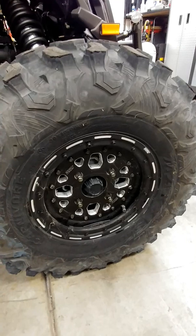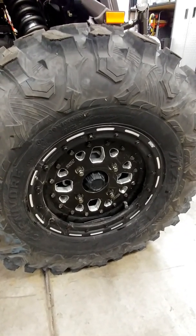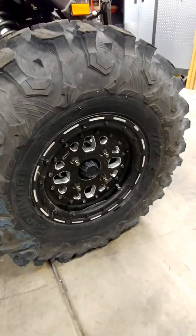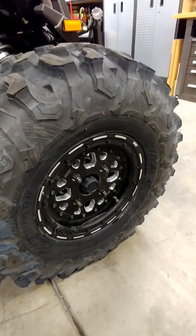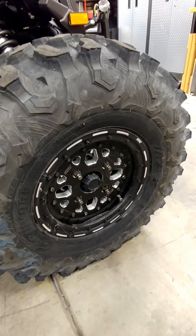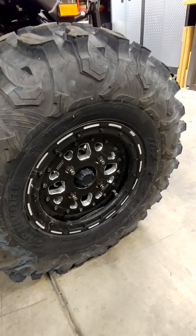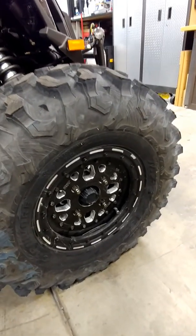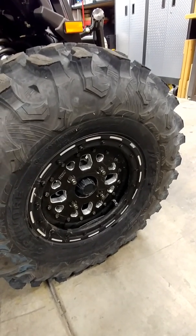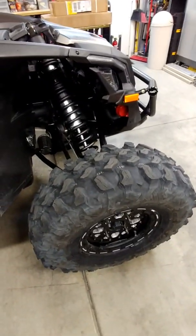It's not the Baja heavy-duty. The wheel beadlock runs about 14.6 pounds. The combination of the tire and wheel for the DS model adds about on average eight pounds per corner for your unsprung and rotating mass. You notice the mass a little bit and the extra inch in tire height on acceleration, but not enough — you really have to be paying attention to notice a difference.